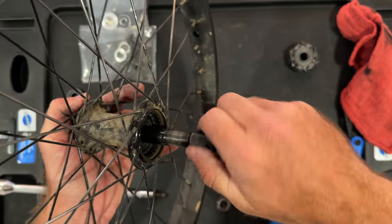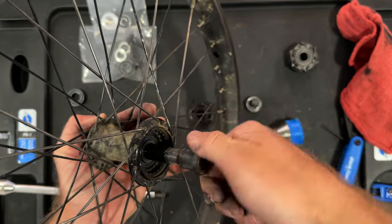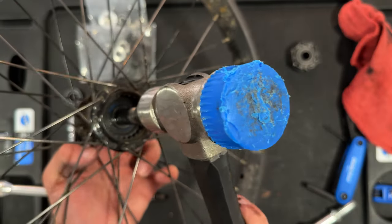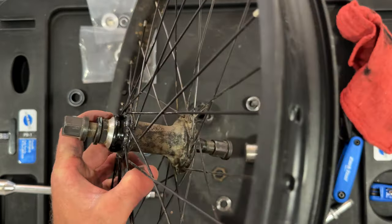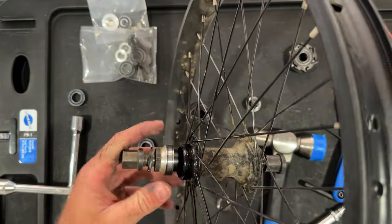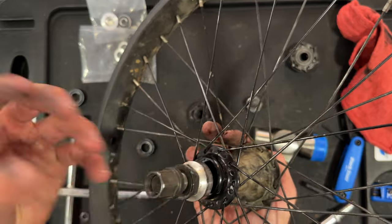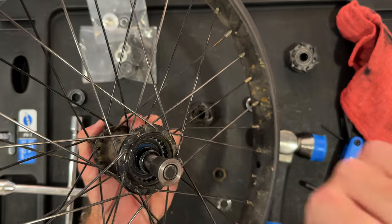Put the axle nut on upside down because it has a larger surface area for hammering. If you have a male front hub, this will be similar if it has hardware that threads on. Now that the axle nut is threaded onto the axle, we're safe to hit it without worrying about messing up our threads. We hit it — bearing is out the other side. Once the axle nut comes off we can slide the axle out, take this off as we did with the front hub, and then hammer this other bearing out through this side.